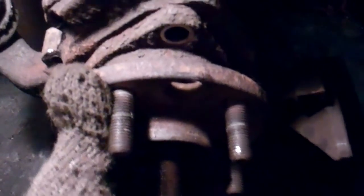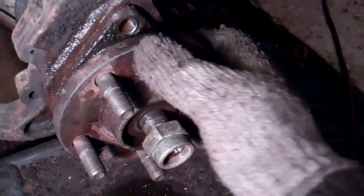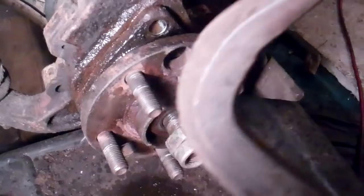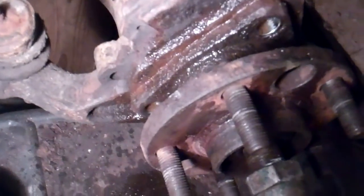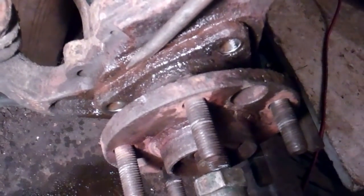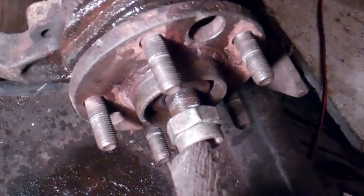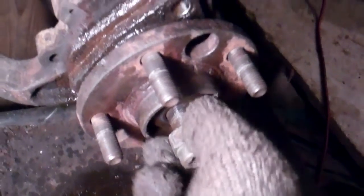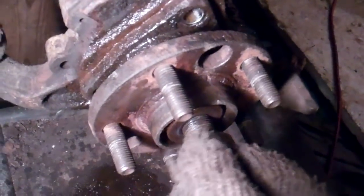The three hub mounting bolts with the torx head have been removed. This hub will need a little persuasion but should come off now. The manual is a little misleading — it says wiggle the hub and it'll pop off. I've been going at it with a pry bar between the hub and the steering knuckle and making a little progress. I put the spindle nut back on and gave the axle a little tap — not too hard — and you'll see that it'll actually move. Be careful not to put too much pressure on the axle.